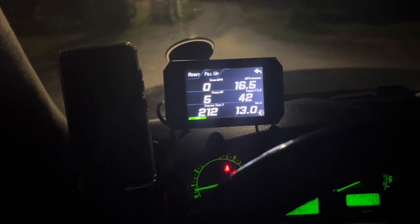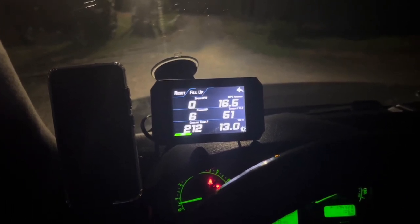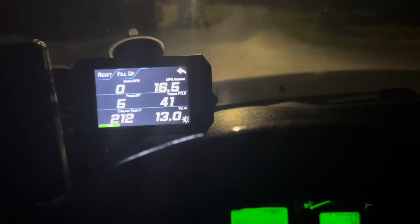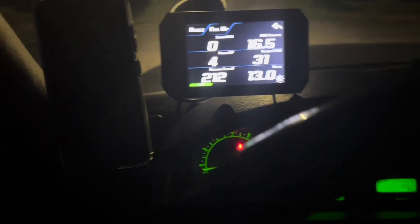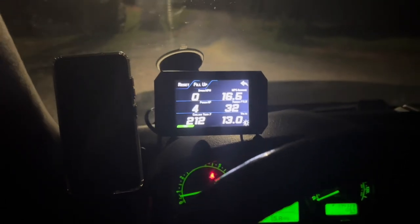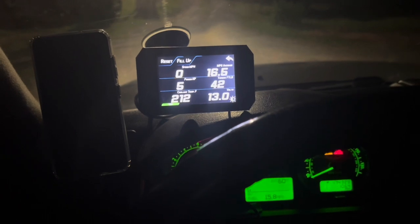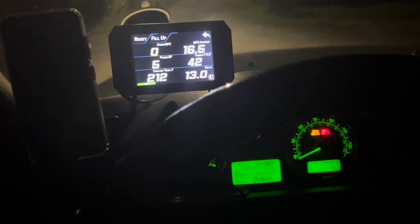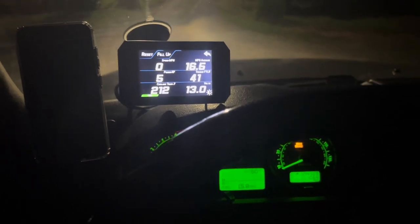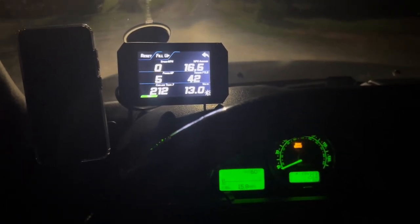Well, at this point, it's not really impacting anything with AC being on. It's not going any higher as far as the temperature goes. I'm trying to blow AC on cold, and it's really not doing anything. So let's turn AC off. Now I have to do economy mode, actually, and blow heat on high. Since there's no thermostat, obviously the air coming out isn't cold and it isn't hot. It's going to be coming out cool, because water is always circulating. So what I want to find out in this test is, if I run it on hot and on high, will the temperatures drop?